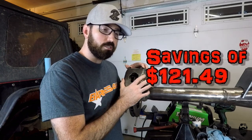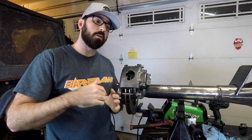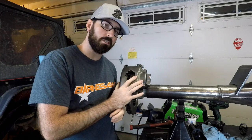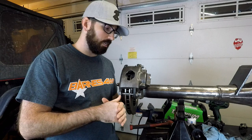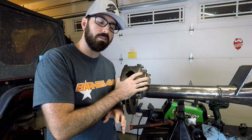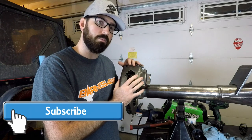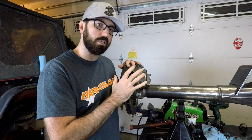To get into any bolt-on bracket, it's going to be at least $350. I know there's going to be more than a few of you wondering why I'm not using an e-brake with this setup. One, the cost is very high — you're starting at like $500 to do an e-brake setup on one of these. Also, the actual calipers that would fit this bracket are from only a two-year run of the Cadillac Eldorado rear calipers. They have this big spring on them, and from what I've read on the forums, they're not very reliable — they seize up a lot — so I'm staying away from those, trying to keep it super simple.